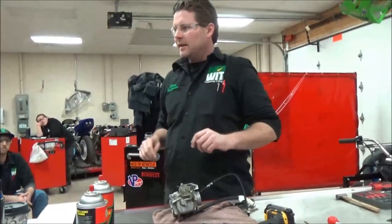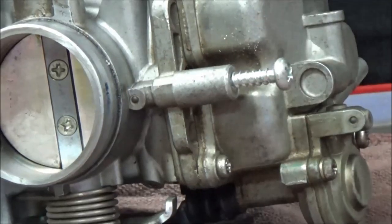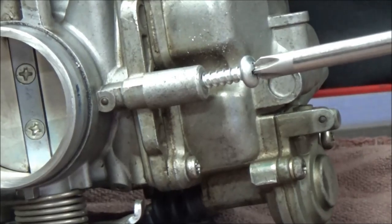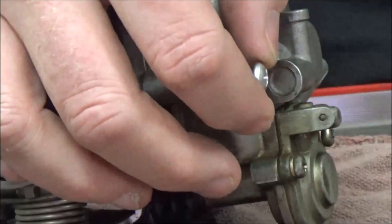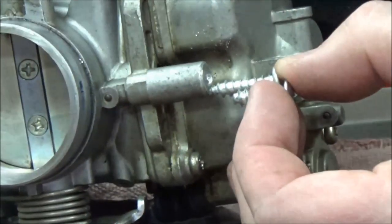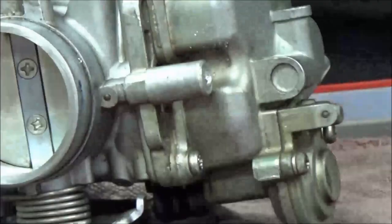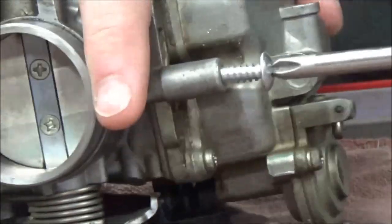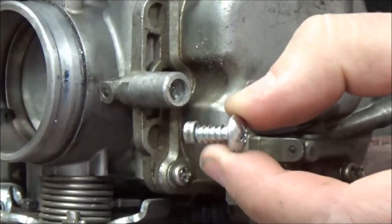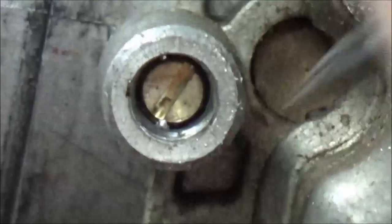So now we're on to the next problem — it's going to be the slightly harder way to do this. When you get a jet kit, they give you a wood screw something like this. In the jet kit they always say put this screw in and try to bite into the drilled hole to pull the plug. If the screw does not grab, what I'll do is back off and use another screw that's one step bigger, but with the sharp point ground off. What's happening is that sharp point is hitting the screw underneath. This is just a little trick to break that seal if it doesn't want to bite. And there's your welch plug — didn't even touch the screw. That is how you get it out.